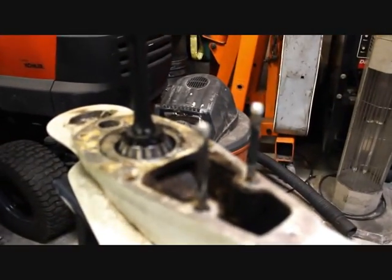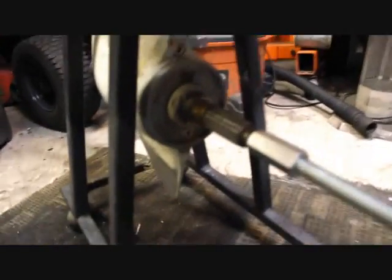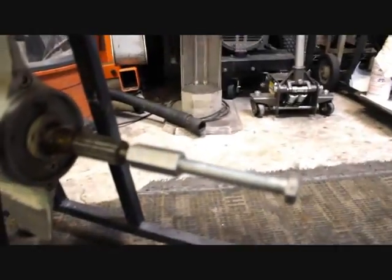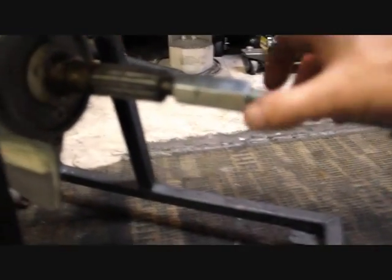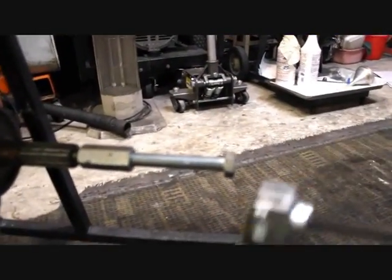I had to drill those out and they didn't really come out too well. Down here we've got to take our trim ring off — which really doesn't have to come off for the bearing case to come out — but these two big bolts have to come out. Then there's this special Volvo part number, basically an all-thread bolt, and another bolt on the back side. What it's supposedly meant to do is you grab this, put a come-along — I mean a dent puller — on it and give it a yank, and it's supposed to pull it right out of the case.